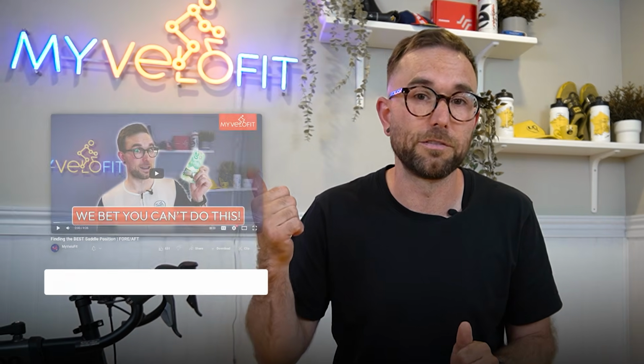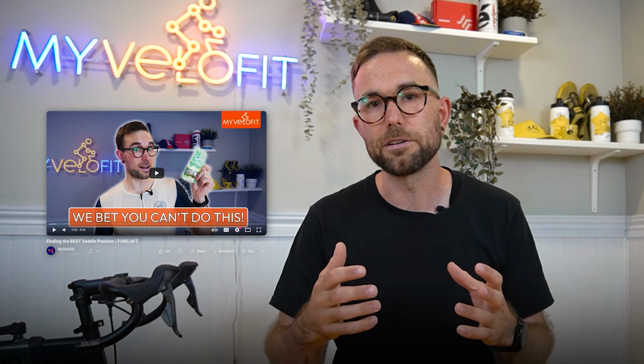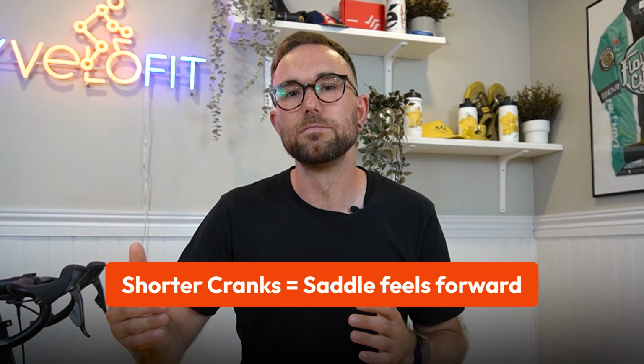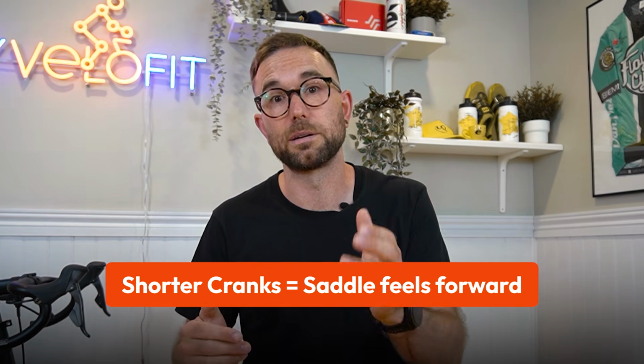And if you want to watch, we've got a whole video on how to establish your saddle fore aft and how it impacts your weight balance on the bike, and those two things play together. So in short, if you reduce your crank length, your saddle may need to go back. If you increase it, it may need to come forward. So now that you've adapted your saddle position, which is the first step and maybe the last for many riders, we'll look towards the handlebars.